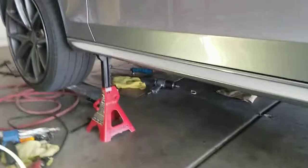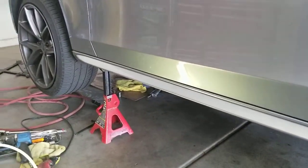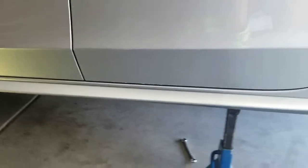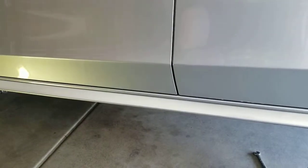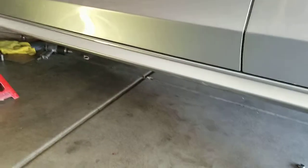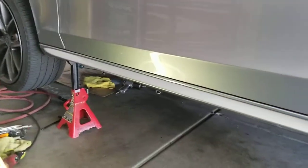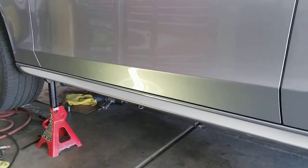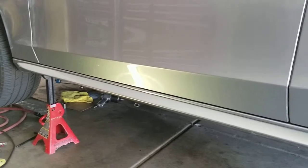No leaks. I've got my cross member off still — I'm gonna keep it off for now. I'm gonna fill this thing up and then probably sandblast it and paint it since it's got some rust on it. We're moving back to Chicago, back to the Midwest, so we're gonna salt-proof the undercarriage of the car. It came from Illinois but still — get it more ready. Right now just waiting for the trans to warm up, about 40 to 50 Celsius, and check the fluid again.